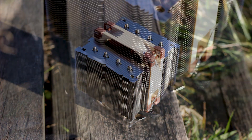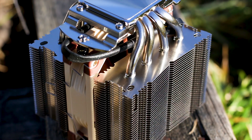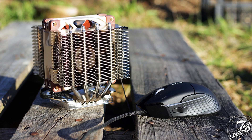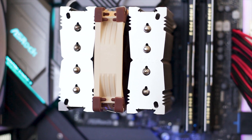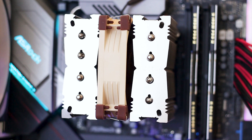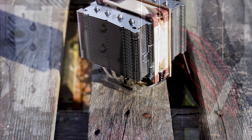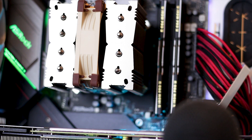The build quality is very good and on the same level as the Noctua NH-D15, with a solid nickel-plated copper base plate and four heatpipes directly soldered to the base plate and cooling fins. Regarding price, the NH-D9L is directed toward a specific user — mainly the small form factor crowd. You could get the NH-U9S for roughly the same price and get better performance; however, the NH-D9L is smaller and close in cooling performance to the NH-U9S, so you'd only choose it if space is restricted and the NH-U9S does not fit. Otherwise, better options exist at the same price, such as the NH-U9S or NH-U12S.